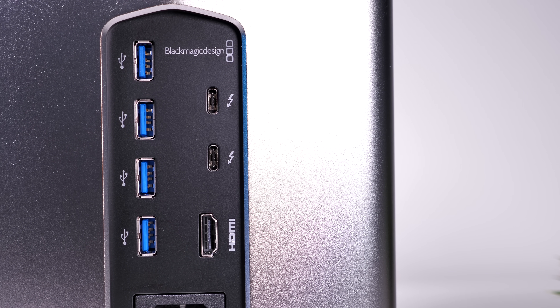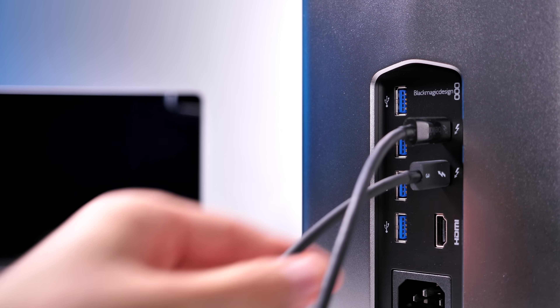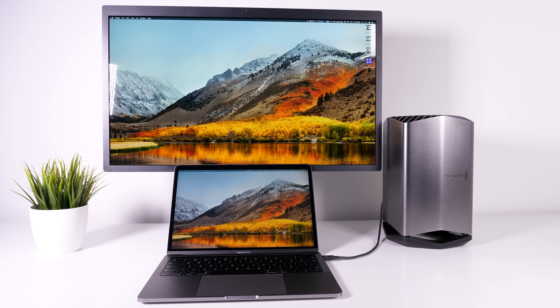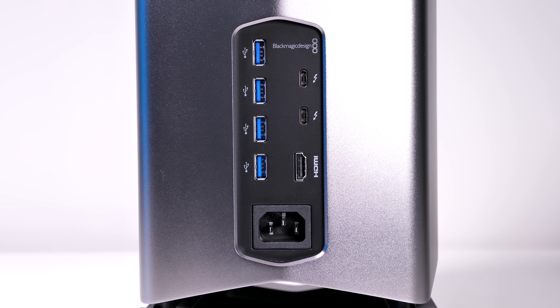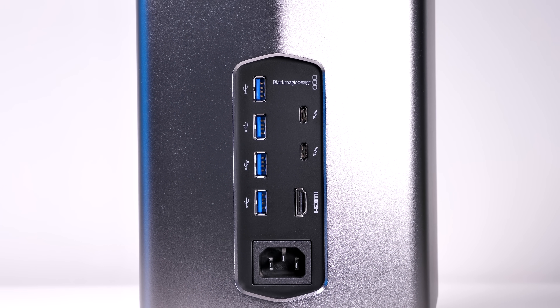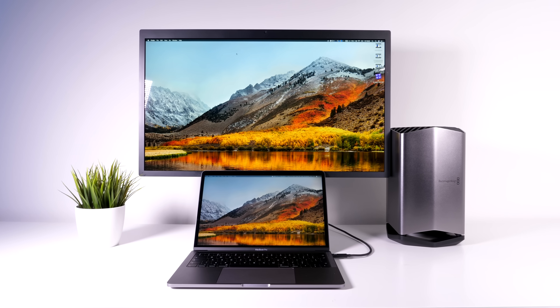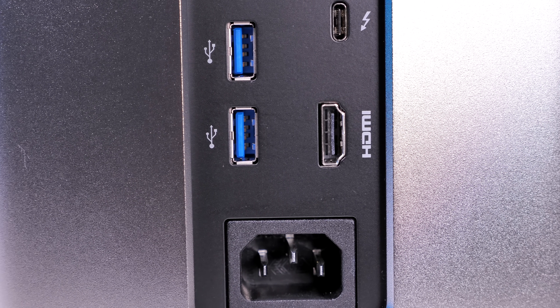In terms of ports: there's an HDMI 2.0 port on the back, two Thunderbolt 3 ports — one goes into your MacBook and the other into the 5K monitor, though you can run both on the same cable at a performance hit — and four USB 3.1 Type-A ports for external hard drives, mouse receivers, and more. Those are pretty much all the good sides: great design, very silent, easy to use, LG UltraFine support, and extra ports.